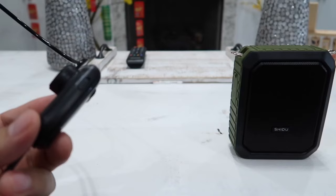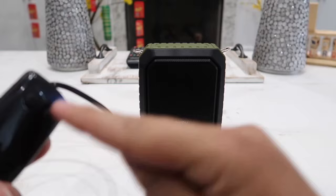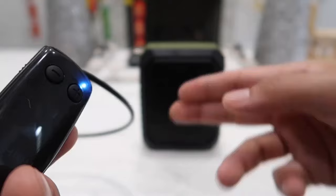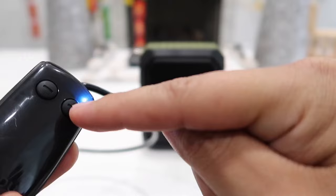When you hear the 'UHF connected' notification, you know the wireless microphone is connected with the speaker. Regarding the screeching sound — the louder you turn the volume up on the wireless microphone, the easier it will start to screech. Always keep these two units about two feet away from each other and you will not experience the loud screaming. The volume for the microphone and the speaker are controlled independently right on the mic itself — increase or decrease the volume with the plus and minus buttons.